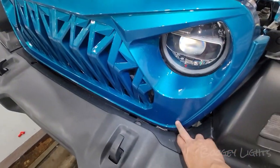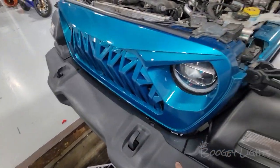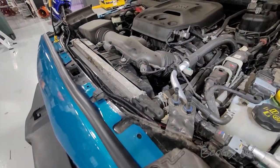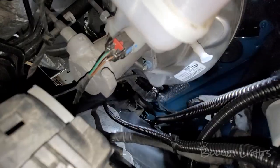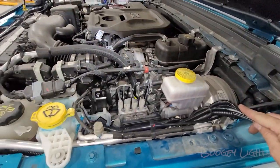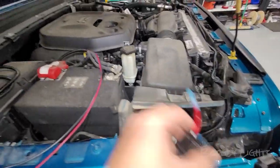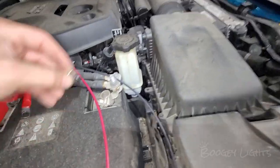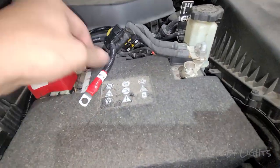For the front wiring, the removable grill has a quick disconnect plug in the bottom right corner, which runs up along with the underglow strip shining down. The passenger side wheel well runs along the front by the radiator with the 12-gauge power wires, and all of those join up with the driver side wheel well coming out right there. The sides come up through the wheel well at the bottom — so all strips connect right here. We strip the wires back, get our caps on, with all red, green, blue, and black wires coming together. For the battery connection, we take a 40-amp fuse holder, put it inline, and connect that directly to the positive terminal, then put a 5/16-inch battery lug on the ground wire and connect to the negative. Last step: connect the battery lug to the terminals, pop a fuse in, and give it a go.